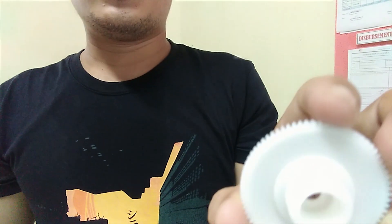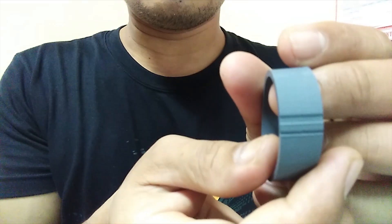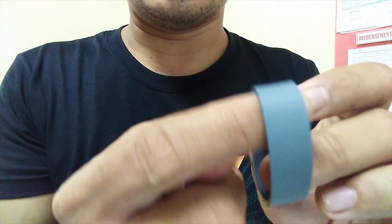What we did was buy a replacement for this one so it will work. We have a new one — the old one will be replaced. Another problem sometimes why the paper could not be fed is because of the rubber on the pickup feeder. As you can see, it becomes thinner than the original one and it becomes smoother, which is the reason why it could not pick up the paper.